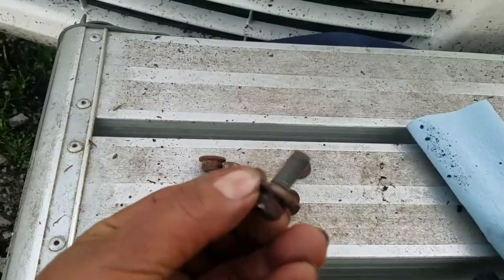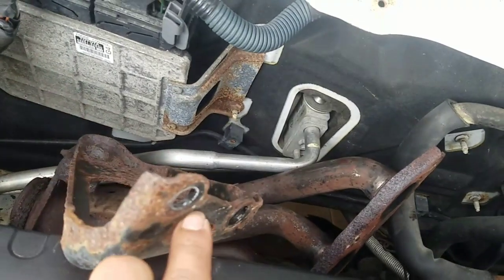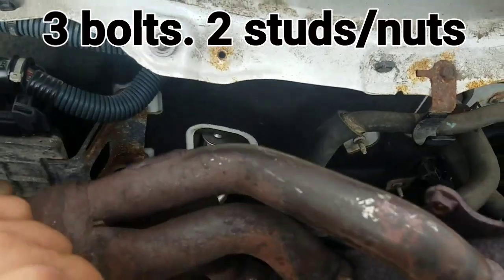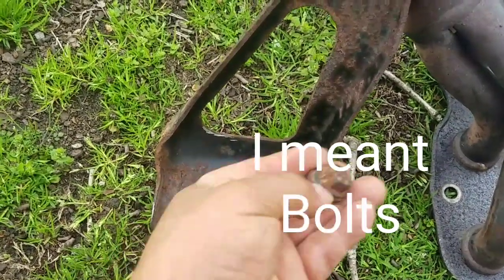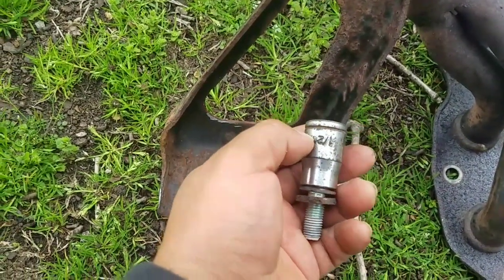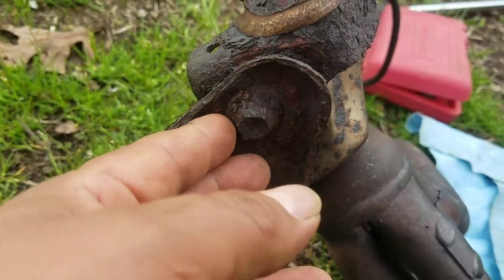There are three bolts right here — still okay but I'm going to change them anyway — and three studs with nuts over here. They came out okay. After removing two nuts from the bracket, make sure the bracket comes out first because of the tight space. The reason I moved these nuts is because they're really bad and hard to get out from down there. I had to grind the head down to a smaller size socket so it would fit perfectly, then hammer it in.